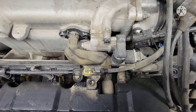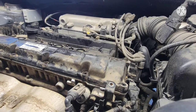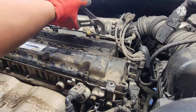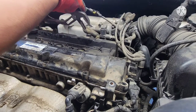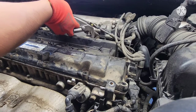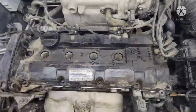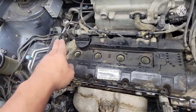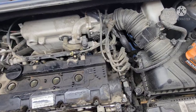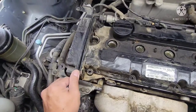There are a couple of hose clamps right there — you need to take those hose clamps off and everything should be detached from the valve cover. Then we'll start taking the valve cover off. Use channel-lock or long-nose pliers — just squeeze and pull. Be careful, those hoses are plastic, you don't want to break those. Remember: five bolts on the front, two on the passenger side, five bolts in the back, and one on the driver's side.